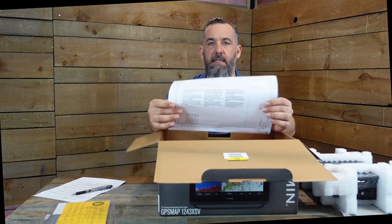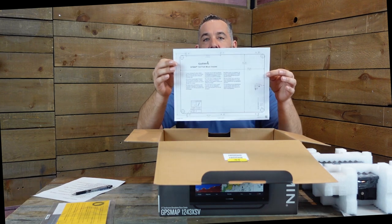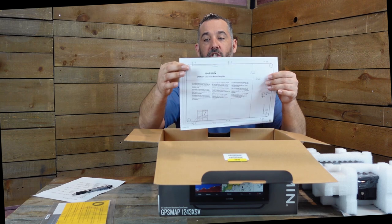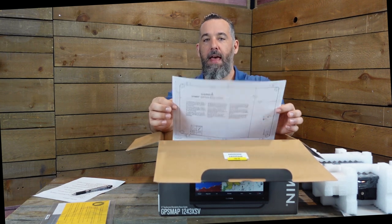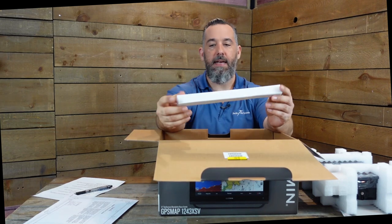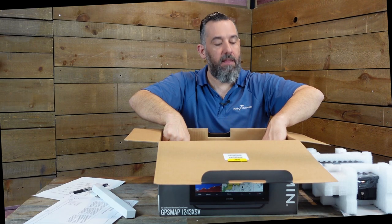The cutout template is a great feature that all manufacturers include. If you're wondering how you're going to install this on your dash, you don't have to measure and guess - the template is made exactly to the dimensions of the cutout. You affix it to wherever you're going to mount it, and it even shows you where the drill holes are going to be, making the installation as less nerve-wracking as possible. Also included is a bezel - a top and bottom piece that mounts over the screws so you can't see that the display is fastened to your dash.